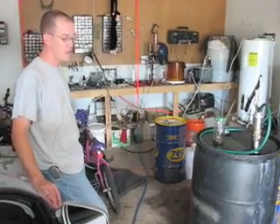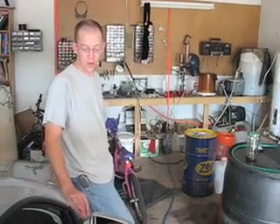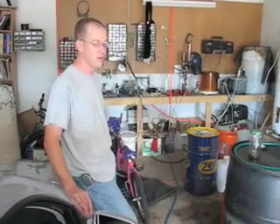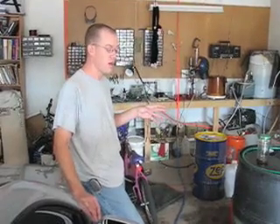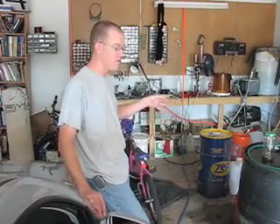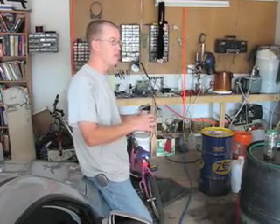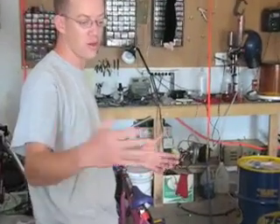None so far — the car doesn't seem to care. It definitely smells different; it doesn't smell like petroleum diesel anymore. They say biodiesel is a better solvent than regular petroleum diesel, and one issue with running it in a car — usually one with much higher miles — is that it acts as a solvent and loosens up any deposited gunk from the last hundreds of thousands of miles you may have driven, and will wash those forward. So depending on the miles of the car, within 500 to 1,000 miles after starting to run biodiesel, you should probably change the fuel filter. But we haven't noticed anything in this car.